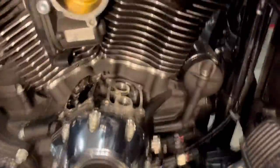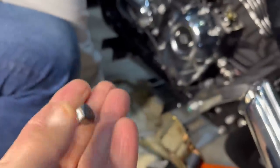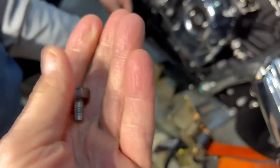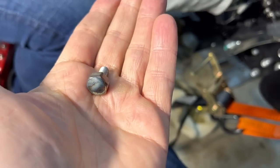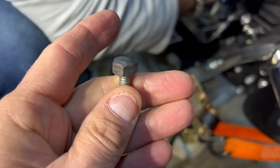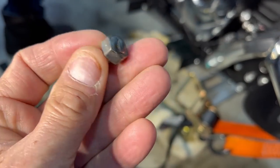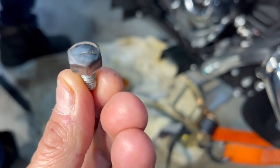Could you imagine that one bolt, one small bolt, caused all this drama for so many people that didn't sleep at night? And this is all it is. It's like this bolt, and I'll show you again how nice, how they extracted it. The stud that was sticking out, they put a nut through it and then welded on the top, and then they get more leverage. And they said they heated it up with a little torch, and they got it out.